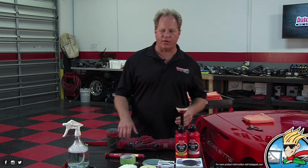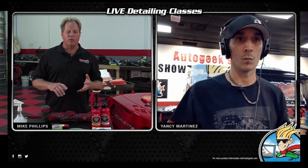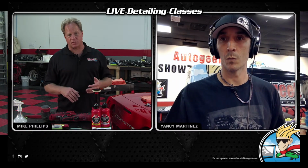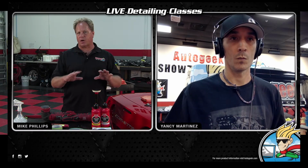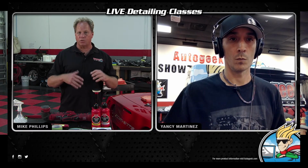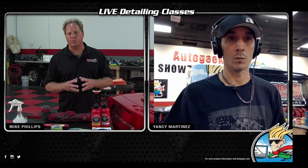I would do a test spot before I would try to machine sand single stage white paint. In my experience, I have found it the hardest paint to work on because of the pigment, which is titanium dioxide powder. But in context, there's not a lot of new cars with ghosting. So if you're talking about something older that came from the factory with paint, a '68 Le Mans, a Mustang, or something that has graphics or stickers that were on it, and now you want to try to sand that old single stage paint, my advice would be tread very lightly.